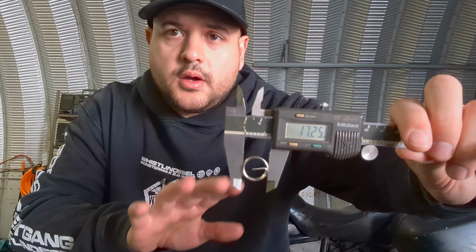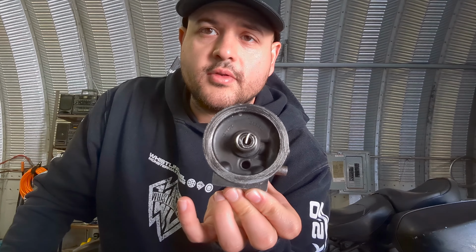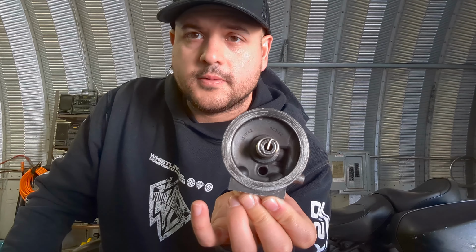And then what you want to do, take your oil filter housing adapter and basically spin that on. So you've got the same pitch threads, they're both 1.5 metric, but all you're doing is making the outside diameter big enough so you can now use that 3387A oil filter.